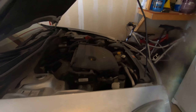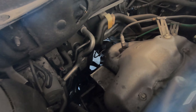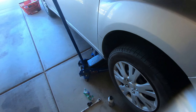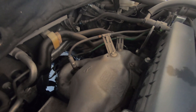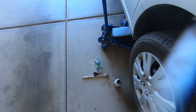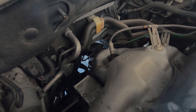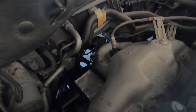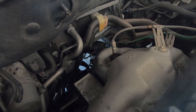All right, here we are. We've got that second O2 sensor down there. I sprayed some penetrating fluid on it just to get it to start loosening up. We've got our jack up safely. I'm going to go underneath the front and reach up there with the O2 sensor wrench - it's that green wire there. We've got the original equipment replacement, which is also green - always a good sign. It plugs in up here, so pretty simple to find. The code itself is interesting - it is an O2 sensor slow response, so a pretty rare code, but it should get taken care of with the new O2 sensor.